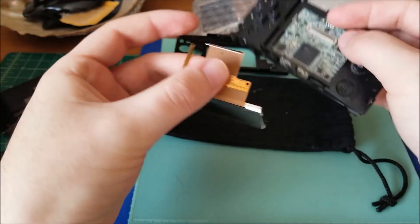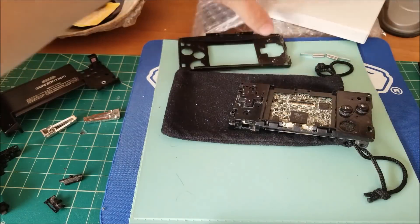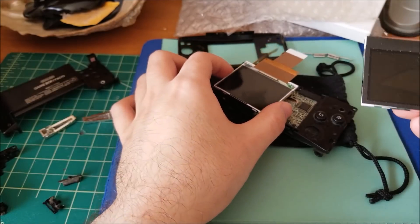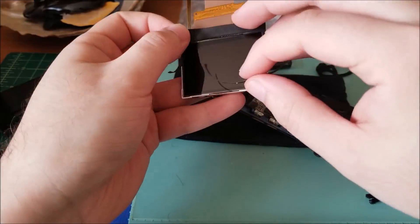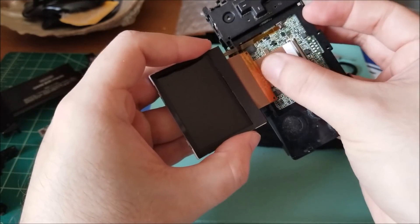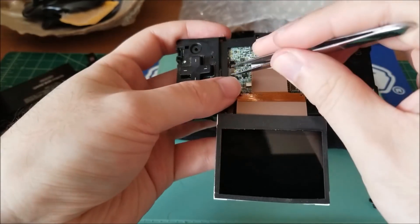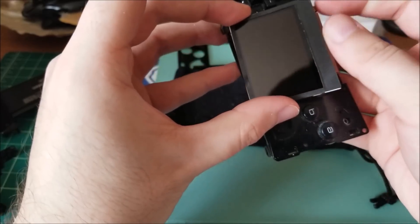Yeah, we can see this one's pretty well and truly toast. The old one went in like this, so I'm going to have to do the same. Looks like there is a bit of foam — let me see if I can get that off and apply that to the new one. Ta-da — back on, and we're ready to go. Data first, because that's easy. Flip that down. Now, tweezers — this is a very small connector, don't force anything. Once everything is in, we're going to have to carefully bend this so it actually fits inside. The pressure of the front is going to hold that in, so once we actually close it up it'll be fine.